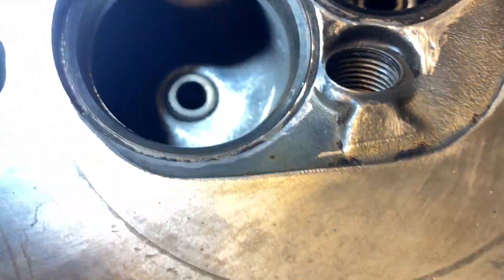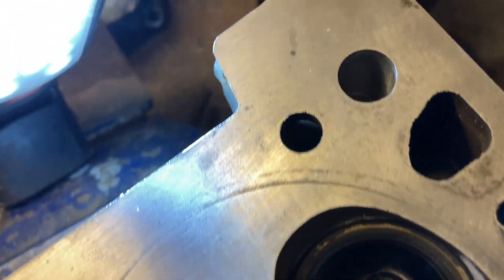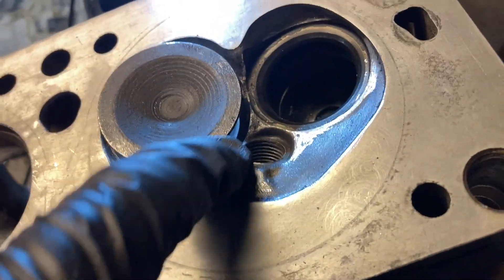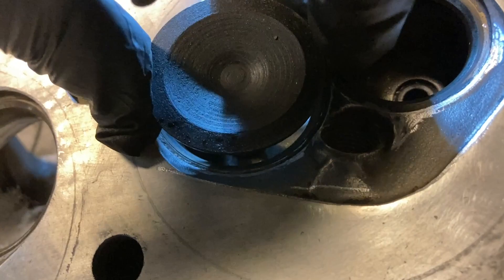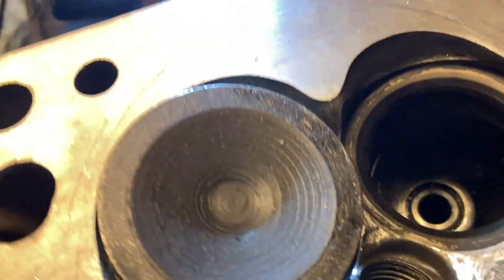There's also a lot of casting marks in there that stop it from flowing well, not to mention carbon buildup which I've cleaned out as much as I can. I'm trying to deshroud the valves — take that lip out from around the valve seat without nicking the seat itself. I'll have to lap the valves anyway. The air is trying to get past the valve, so the smoother and more rounded you can make it between the valve and the combustion chamber wall, the better it's going to flow.